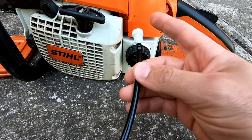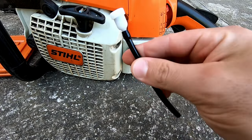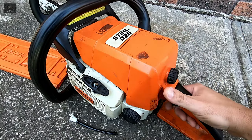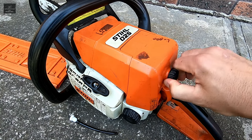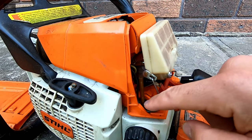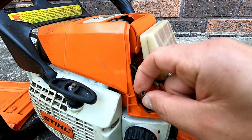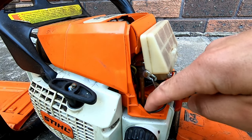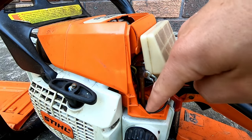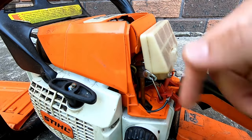I've opted to use a newer style vent line for this chainsaw and as you'll see the original one has quite a different design but the same function. To start we're just going to take off this cover. Here is the original fuel vent line — it's a different style with internal springs that can be adjusted with a small screwdriver, but it's also been leaking from where it interfaces with the fuel tank. I temporarily put a cable tie until the new one arrived and I'll show you how we go about replacing that.